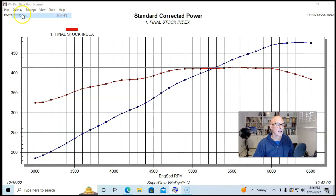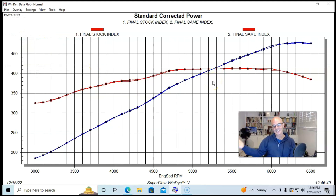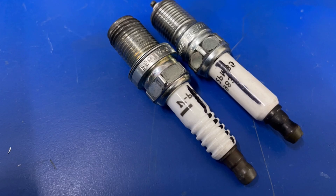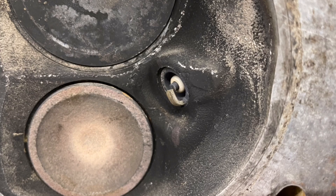Right at 414 foot-pounds of torque. For our first test, we took those plugs out and reoriented them so they were all the same — we didn't care whether they were pointing toward the exhaust or the intake, we just wanted them all uniform. And here's what happened: essentially nothing. We've seen this before — we've taken plugs out of this motor, run them in the 4.8, run them back in the 5.3, not put them in the same cylinder holes, and none of that made any difference. We went from normal random orientation to all the same, and we saw maybe one to one-and-a-half horsepower variation, which isn't enough to call a real gain.